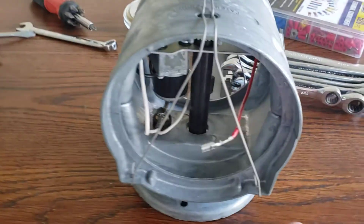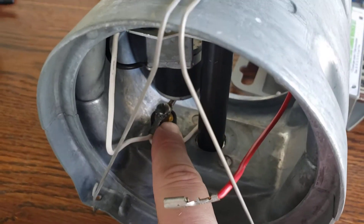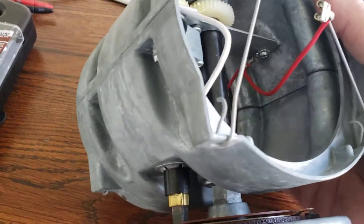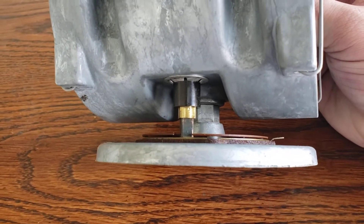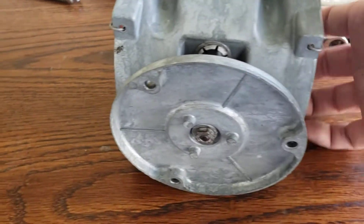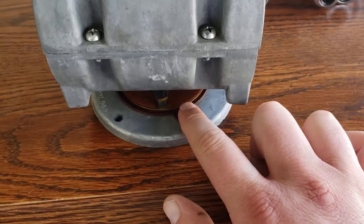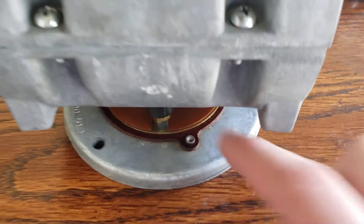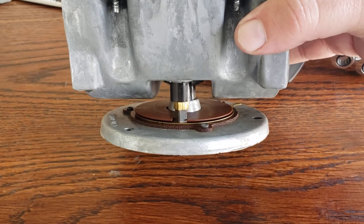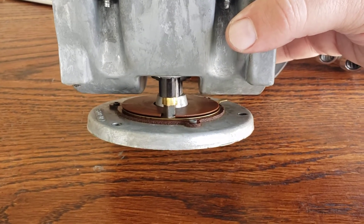The problem is — if I can zoom in here — that right there is the actual brush. And if I flip this around, that's my problem. I've taken this apart already: the bolt on the bottom comes off, then with a little coaxing the whole bottom plate comes off. There's a piece of cardboard-ish material — fragile, be careful — that's supposed to protect the brass contact plate that the brush makes contact with.